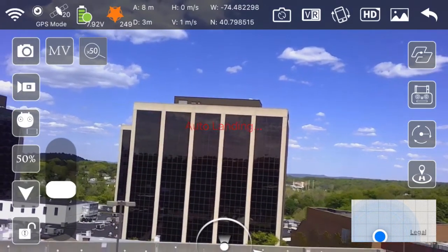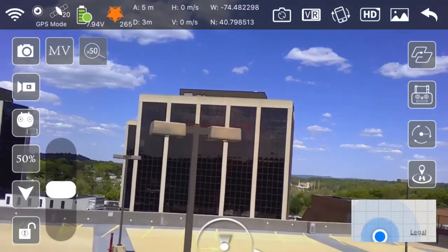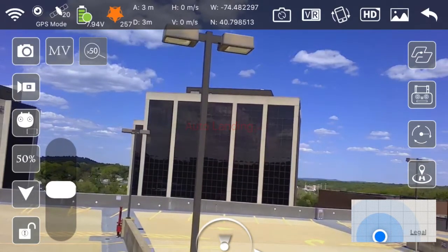This doesn't happen often, but it will happen regardless of the drone's brand and how expensive it is. Another reason I landed was because I noticed the gimbal was crooked, which was likely caused from putting the drone in its case without its camera cover. There's a simple fix for this by holding the speed button on the remote for 5 seconds, which I'll demonstrate later on in this video.